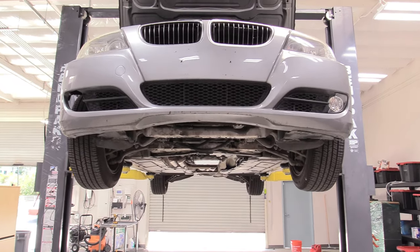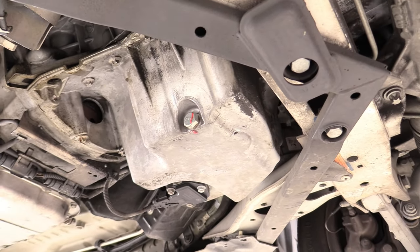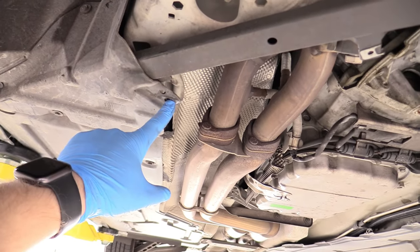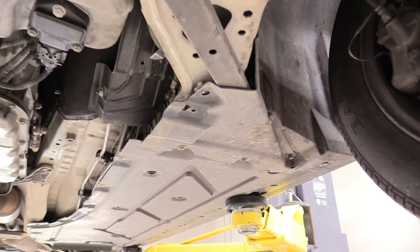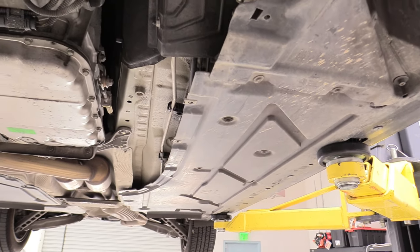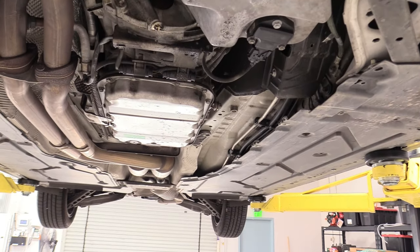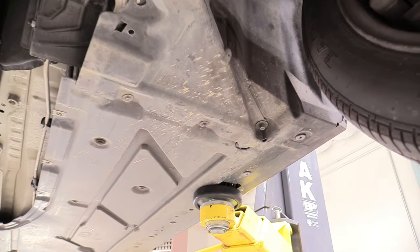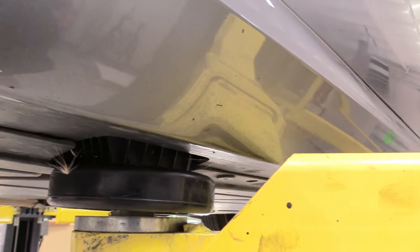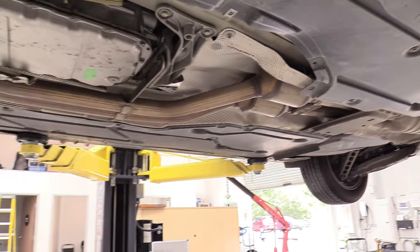Here's the front of our vehicle for reference. This is where we're going to be working today — right here. That is where our oil pan drain bolt is and we have to remove that. There is most likely some sort of plastic plate that interfaces with this right here. If I had to guess, it's going to be six or eight millimeter — looks like eight millimeter fasteners — to remove, just like this skid plate does. But as you can see, mine's missing, so there's really nothing I can do about that. Go ahead and remove that skid plate — it's a plastic skid plate — and then you will be at this step. I have the convenience of a lift, but I also want to point out where the jacking mounts are, where you would want to put a jack or a jack stand. There are little rubber feet that the car can sit on, and that's where I've put the posts for my lift, and that's where you can jack it up or put jack stands.